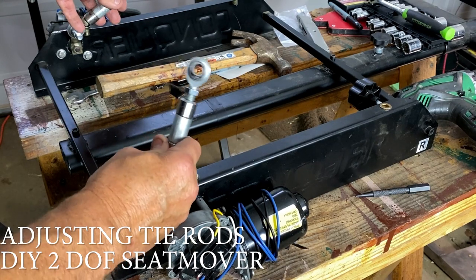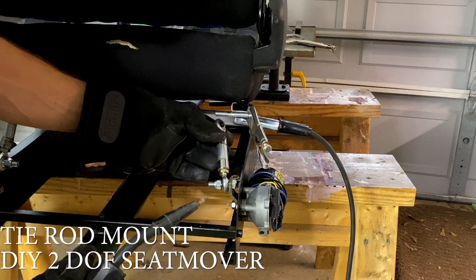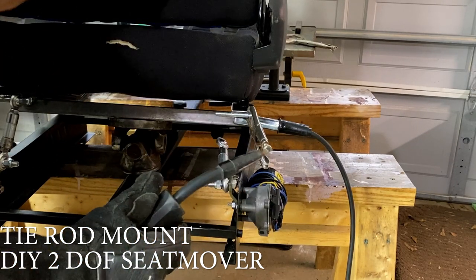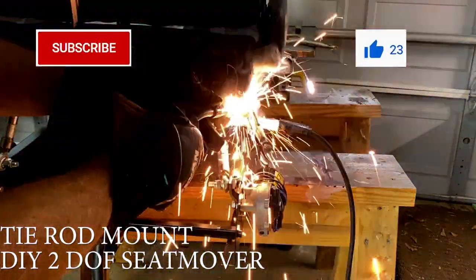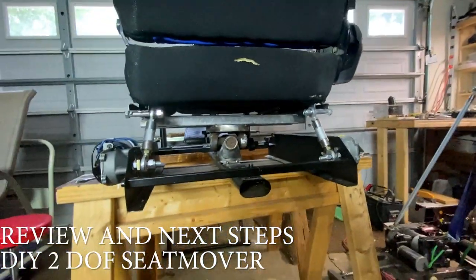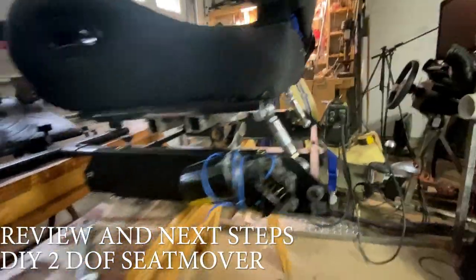I'm gonna hook the left one on the seat and the right one on the seat to get a good reading — this is nice and secure. I'm just gonna tack in this little bolt here that the upper control arm will hook to. You could make a bracket out of mild steel and bolt it in, but I have the welder. Both are tacked in and she's right now at a dead level ride — I put two tacks right here. You could make a base plate and bolt it to the frame, but I just want to get this project rolling.